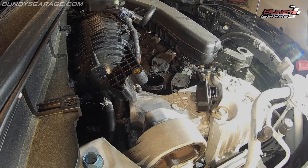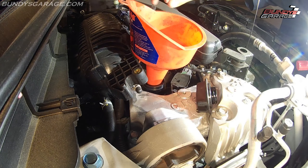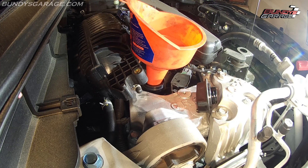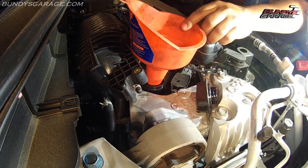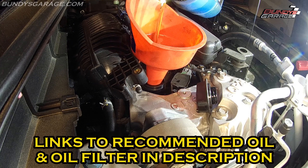Do not start the engine without any oil. Four and seven eighths is close enough to five, so you're just going to put five quarts in. Double-check your oil pan bolt and your new oil filter to make sure those are in place, because you don't want to start pouring oil in and then have it drain right back out of the bottom.